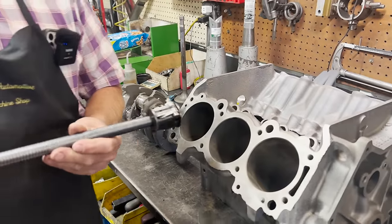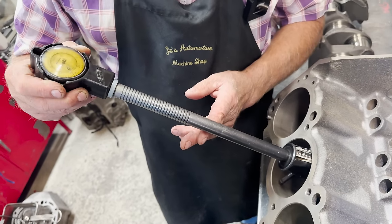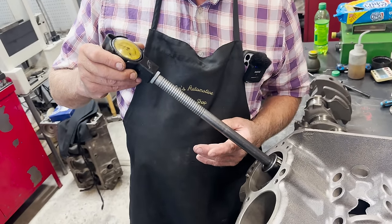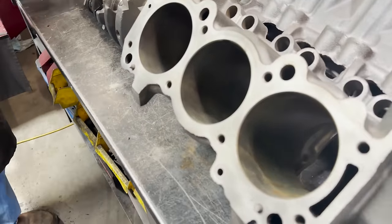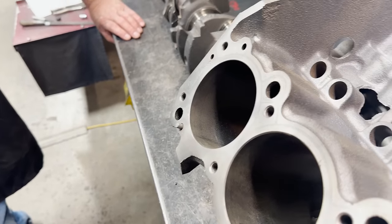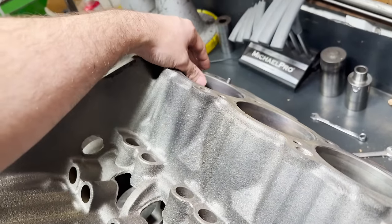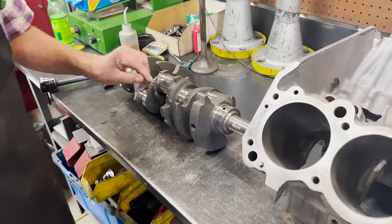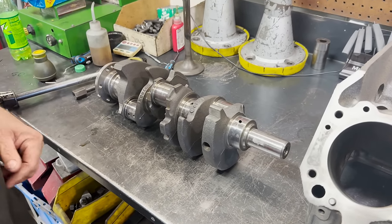I knew this motor was probably in pretty good shape. I set up the gauge to measure the wear in the cylinders, and there's probably not any of them that have more than maybe two or three thousandths wear. This going back in this old Jeep they're restoring — just something for fun, not going to get a lot of miles on it — so they've opted to do an old-fashioned rebuild: just re-ring it and put it back together the way it was. The crankshaft is beautiful; it needs cleaned up just a little bit more and then we'll polish it, but it has no wear whatsoever.